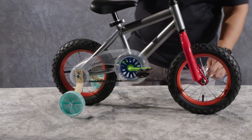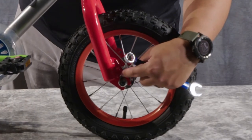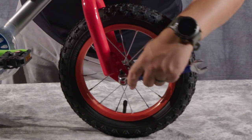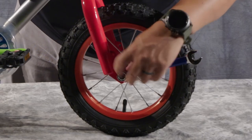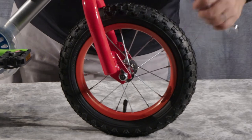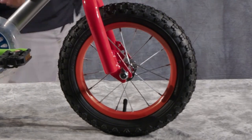In the front, you're going to want them pretty tight. There's no training wheel bracket there. You want to make sure that your dropout washer, your safety washer, is still hooked into the little hole there — just in case you do have any type of wheel loosening situation, you're good to go. These are tight and ready for riding.